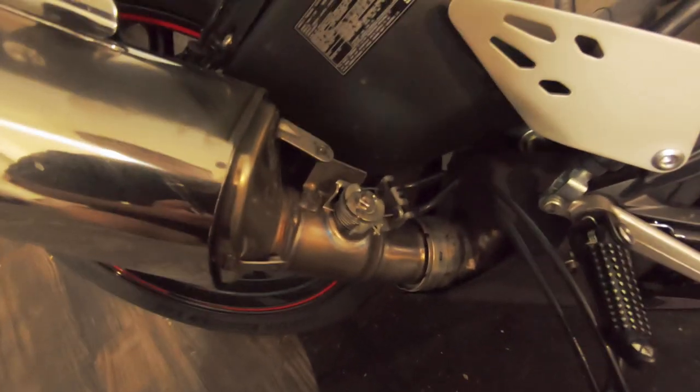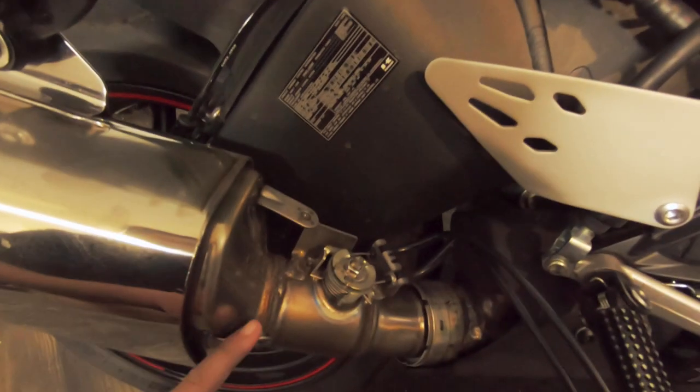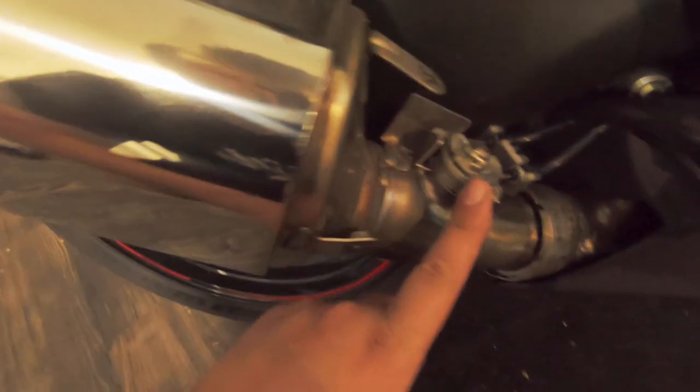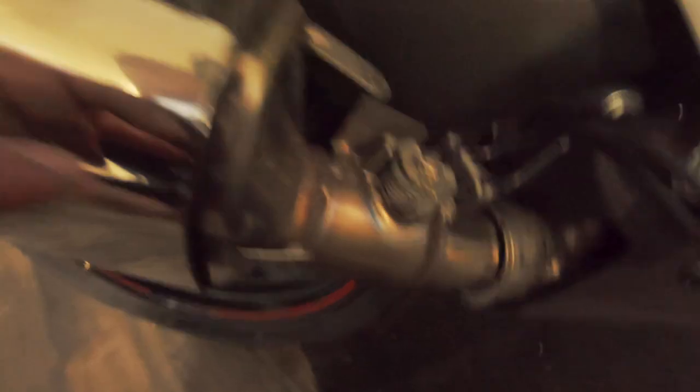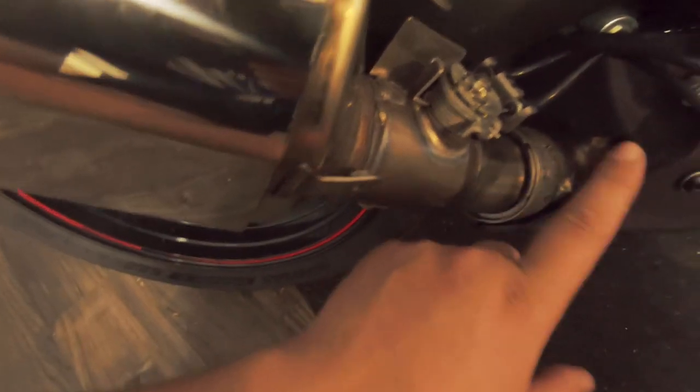Got the heat shield off. The heat shield was a 4mm. This was — I believe it's a 6mm — yeah, 6mm to take the foot pegs off, 4mm to take the heat shield off. It's just two bolts, and then this rubber grommet — just pull it out slowly and it'll come off. Now, instead of removing the servo right here, which is where your servo is, it looks like possibly a 10mm down here. I'll find out for sure here in a second. I'm going to remove the full muffler off and then remove it off the hanger, and then we'll start working on the pre-muffler.